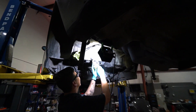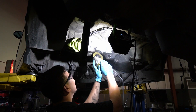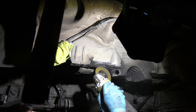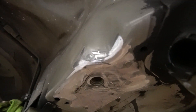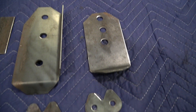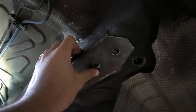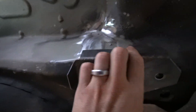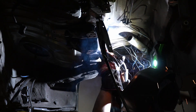Now it's time for the subframe reinforcement process. When talking about reinforcement, we're referring to the mounting points. BMW did have a recall for this, but it ended back in October 2010 and sadly many people didn't know about it. First step: grind off the coating to expose bare metal, then it's ready for welding. These special plates fit perfectly over the mounting holes where the subframe bolts go, then get welded on to add a stronger support point, helping with added stress and preventing further cracking.